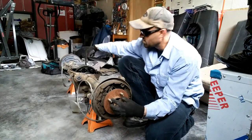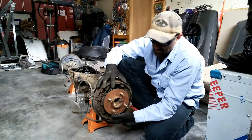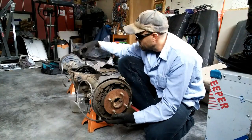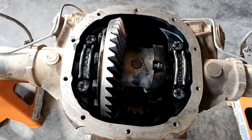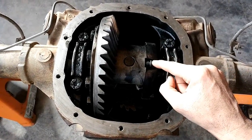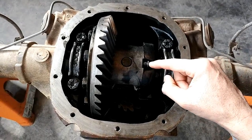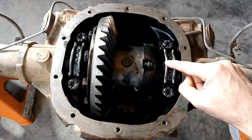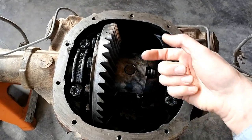This is the axle itself — it goes through the tube down into the center. You've got the axle, a brake assembly, and a fluid line coming from your booster through a distribution block, plus a parking brake assembly. Once you have the drums off, roll over your gear set until you see the center pin and the holding pin. This bolt takes an 8mm socket or wrench — use a wrench to take it off because a socket will lodge against the girdle piece. Once that bolt is out, you can take the pin out and then roll over and take the c-clips out.